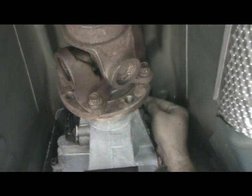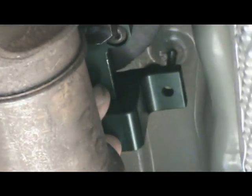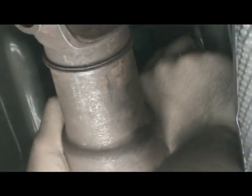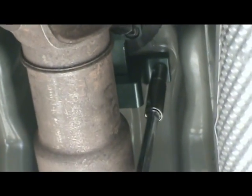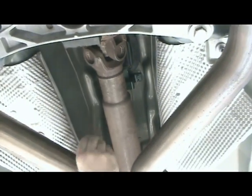With the linkage in the shifter, we can now reinstall the shifter arm bolt. It is very important that this bolt is screwed all the way in by hand. We can now install the bracket, making sure the Barton logo and bolt heads are facing the rear of the vehicle. Start the nuts by hand, but leave the bolts and the bracket loose.